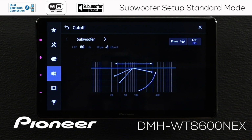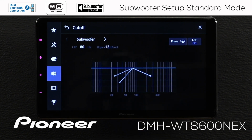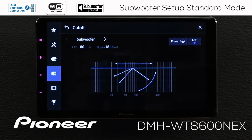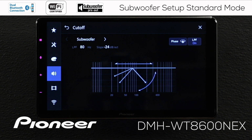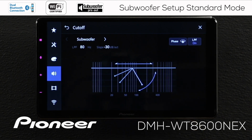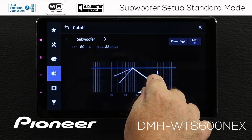Now that's a very shallow slope. We can make it a little steeper if we want. There's 12 decibels per octave. There's 18 decibels per octave. There's 24 decibels per octave. 30 decibels per octave, and as steep as 36 decibels per octave. So any of those settings for the slope will work great for you.